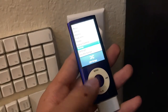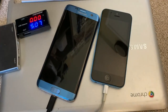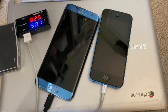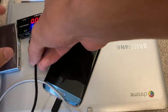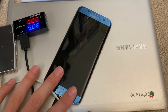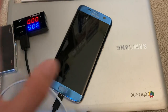I have my little meter here — since you can't see the wall I'm going to have them plugged into the meter. This blue 5C does take a charge but we're not getting anything on the screen, so we're going to tear this guy apart — it probably either needs a new screen or a new battery. For this Samsung, it's showing no signs of life at all, so I'm guessing the charging port is bad. We're probably going to tear this guy apart too. I don't think I have a charging port on hand so this might have to be another video.